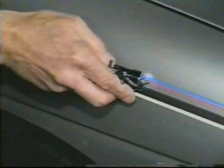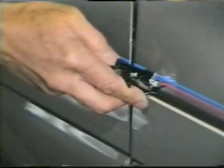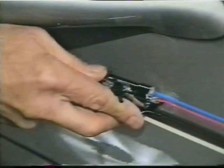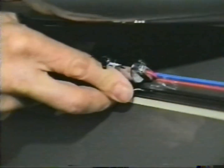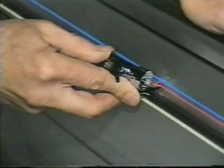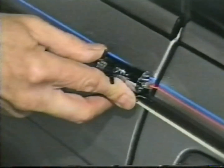There is no need to stripe a car in sections. The entire side should be done in one pass. At a seam, simply slow down and continue on. When slowing for obstacles such as mirrors and door handles, your stripe width will remain consistent. Walk with a smooth, continuous motion the entire length of the car. Even if you need to pause momentarily, your stripe will be perfect.